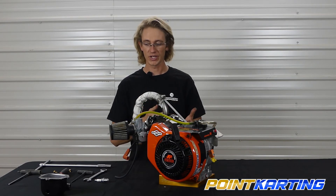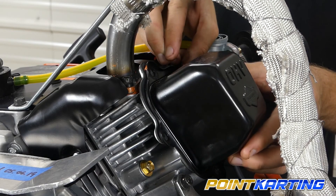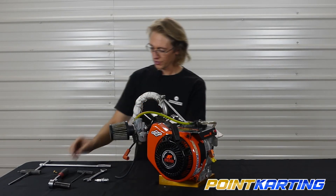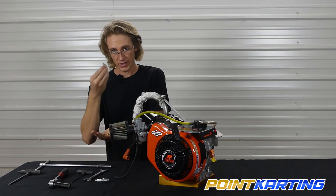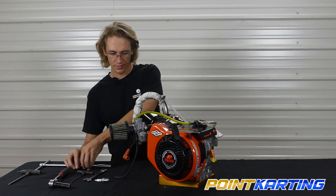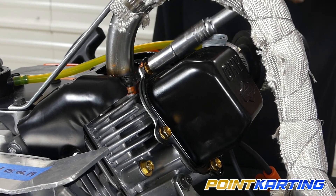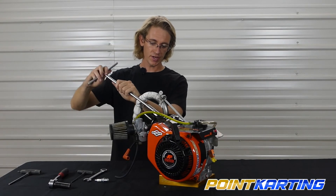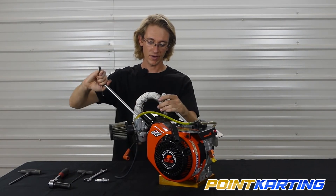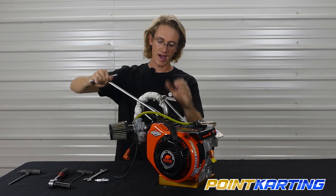Reassembly is essentially the reverse of what we've already done. Take your rocker or valve cover, place it over the valve train and rocker arms, and then by hand re-thread the bolts into the rocker cover support plate. It's worth noting that three of these bolts are the same length but one is slightly longer — that longer one threads into the very bottom of your rocker cover. Once started by hand, take your 10mm socket and tighten them down. Many people recommend a hex pattern, and you can do that, but it's most important to tighten them progressively — I like to work clockwise or counterclockwise around the valve cover, tightening to about half a turn past hand tight.